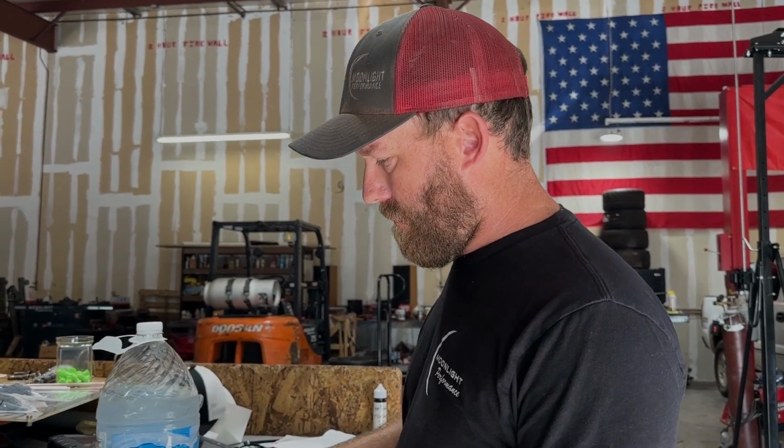What's it looking like today, Lee? Yesterday we had a mishap with the race car. Want to go in on that? Yeah, I ended up lifting the head on like 23 pounds of boost. Happens, race car stuff. It made 1,109 horsepower, so just make a little bit of heat, but it shouldn't lift the head on 23 pounds. So we'll pull it apart, see what happened there. I believe it to be a fastener failure. Get some better stuff put in it. That's all we can do there.